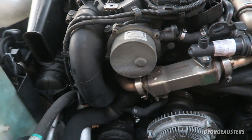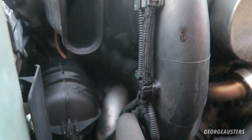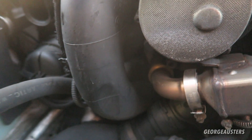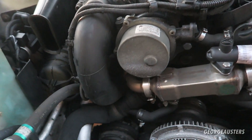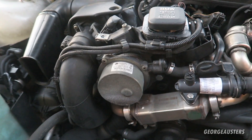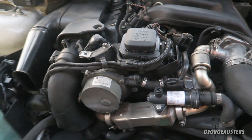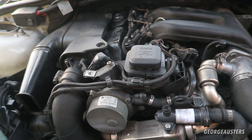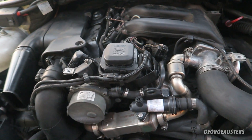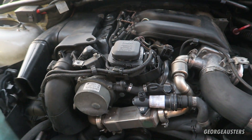The final part — and this is not dead certain to fail around the 100,000 mile mark but is very common — is the turbocharger, which is covered by the airbox. It is very common to hear the turbos on these failing at 100,000 miles or so. The main reason for turbocharger failure is lack of oil changes. It is very important to change the oil at most every 10,000 miles — do not listen to BMW and change it every 16,000 to 18,000 miles. Personally, I like to swap out the oil every 5,000 to 6,000 miles with a good oil filter and proper grade oil.